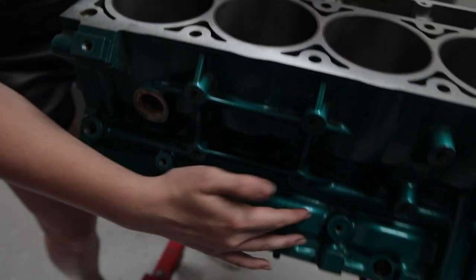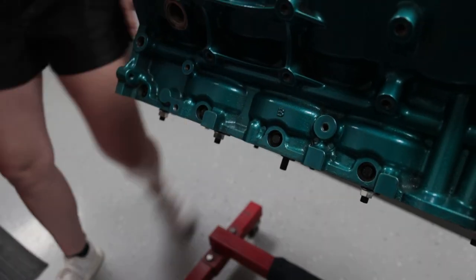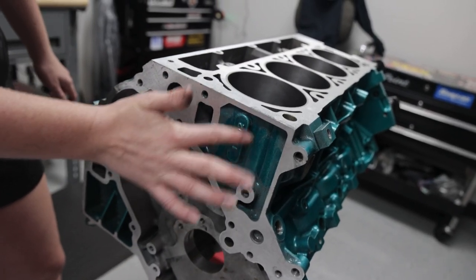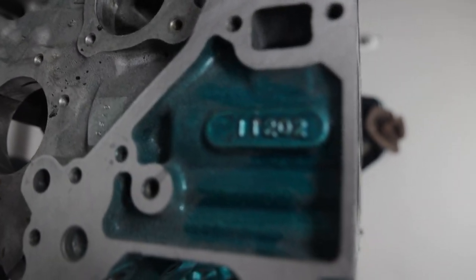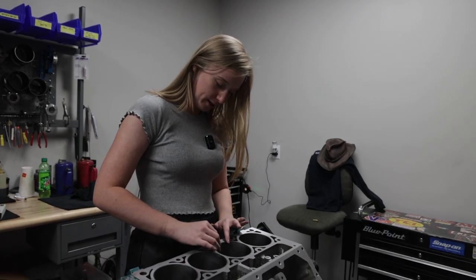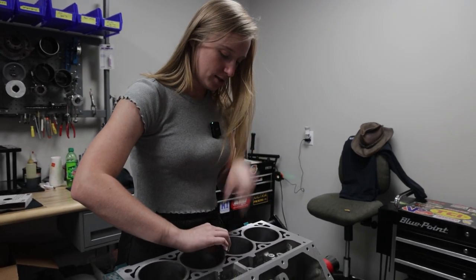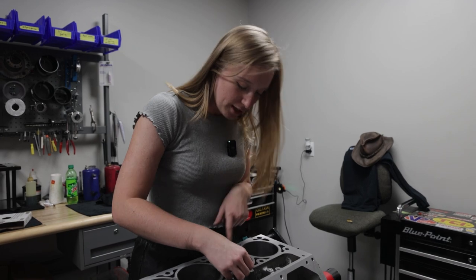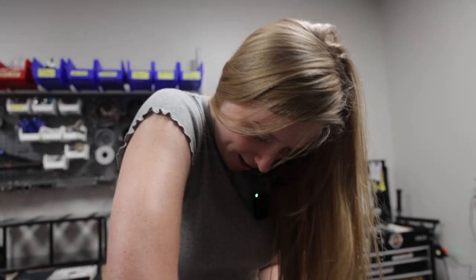This color is just unreal. The top of the camera doesn't really do it justice. I feel like that on cast is so pretty and this is also dusty. I always wondered if this was like the VIN number — I always match blocks to VINs, but who knows? We have this top edge and this top edge that we're sanding down right now is important for assembly. But when we sand the bottom edge, that's the part that will cause problems when it's running. The bottom edge is the most important edge and yet it's the hardest to see where you're actually sanding.